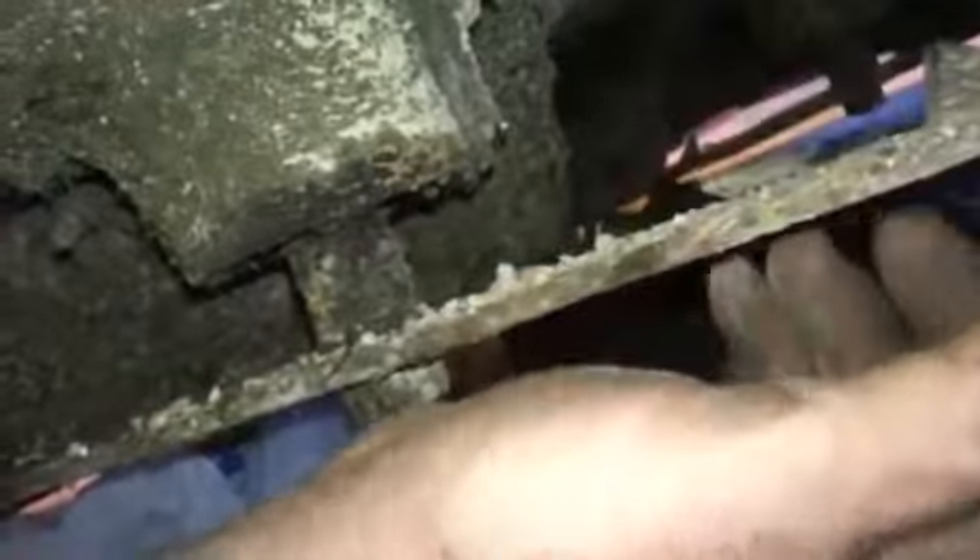Since I was talking about spindles, I want to show you what a bad one looks like. That one and the center one aren't too bad — I rebuilt these last year — but there is movement in this one. You see how that moves back and forth? That spindle is junk. All three of these need to be replaced on this machine; I've rebuilt them so many times the housing is worn out. It's time for new ones.